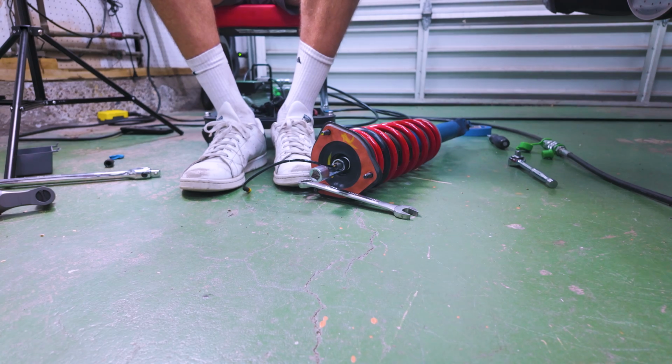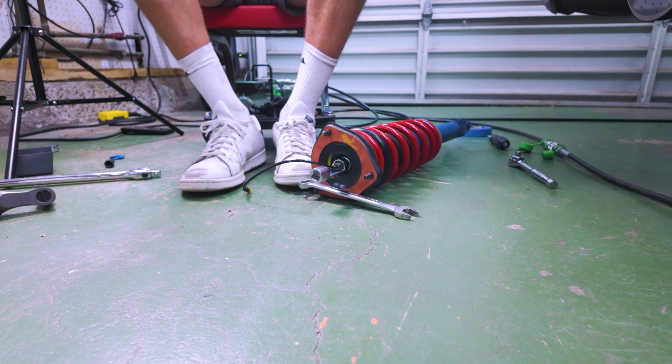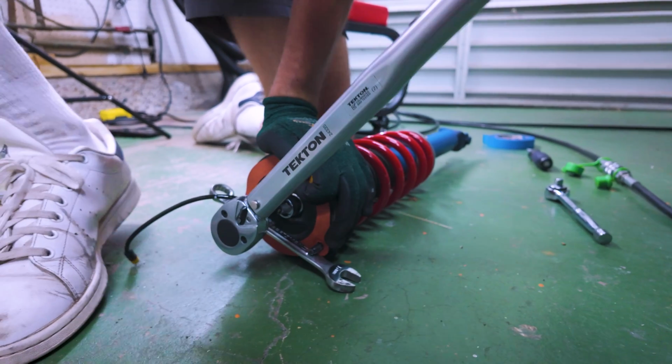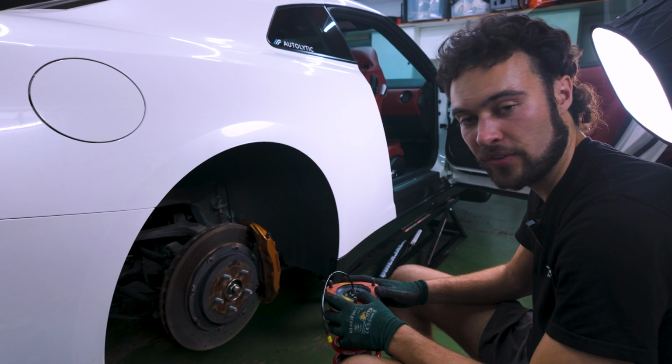We're kind of back into the same setup we had when we were taking this off. We have a wrench under to kind of prevent it from spinning. The torque spec is 44 foot-pounds, so I got my torque wrench set to that, and we'll go ahead and tighten it up here. Woo! 44. So it's time to put this back on.